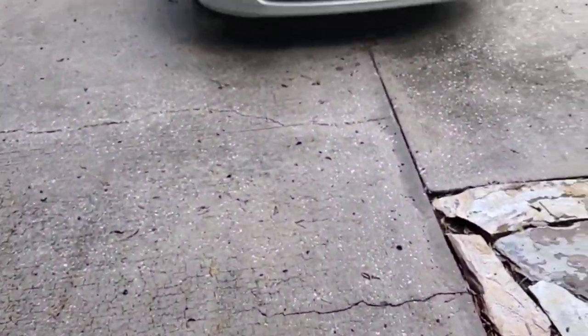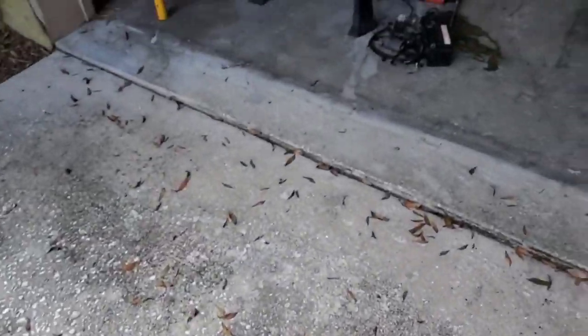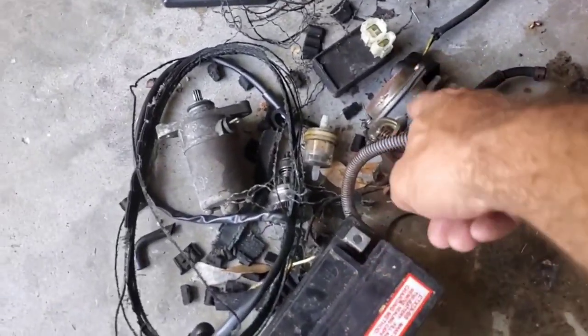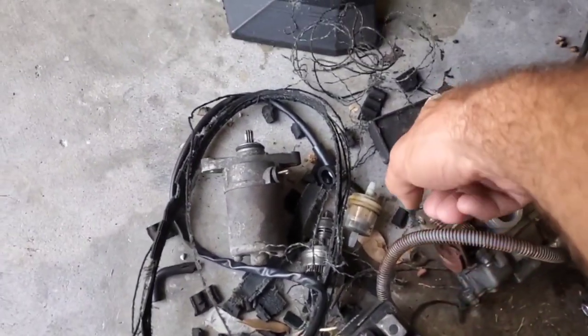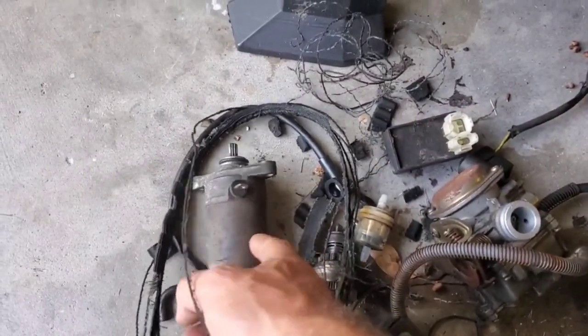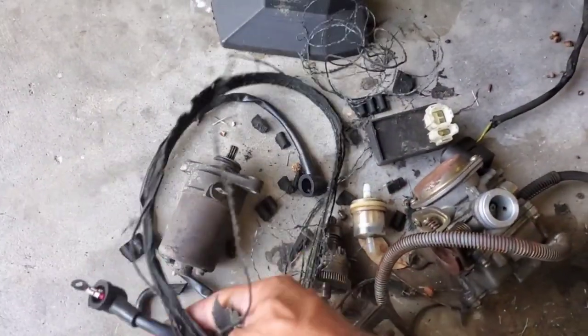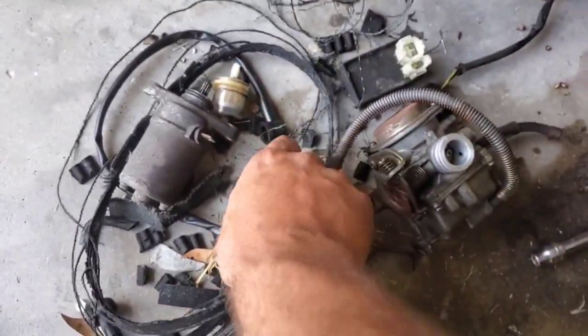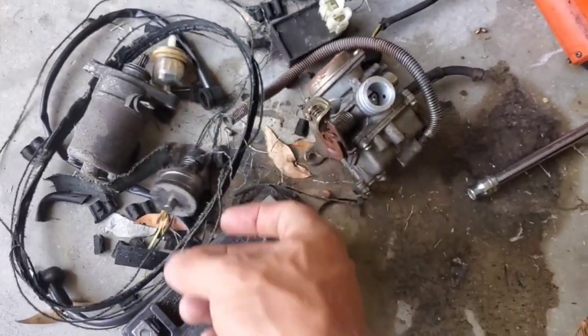That's my bike — put my Gatorade down. This scooter was trashed, it's crazy how much work I've had to do to this thing. I had to put a new battery, new carb, CDI was fried so it wasn't getting spark, starter was absolutely bound up. This is the old belt that was on there — had to put a new belt on it, new fuel line, fuel filter, new Bendix starter clutch.